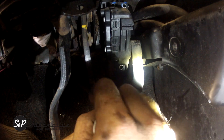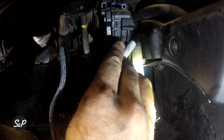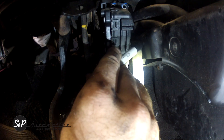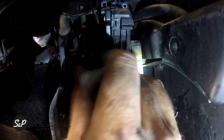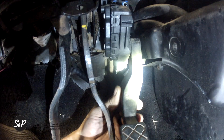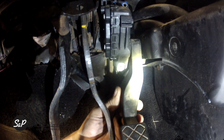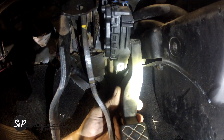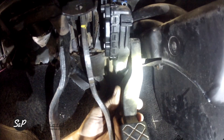I just hold this up and make sure I'm aligned with my bottom one for height reference, then make sure I've got just a little bit of extra room and trim this out. If you happen to find one of the early Mark 4 drive-by-wire pedals, they are actually straight and you can fit them without modification, but they're not real easy to find.